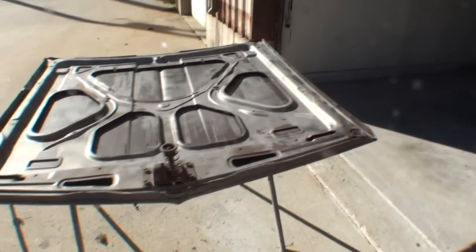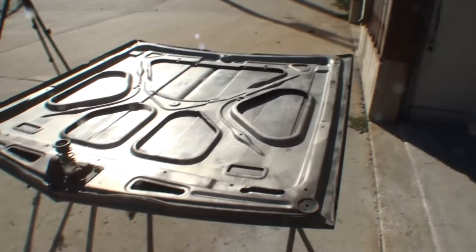The problem when you have metal soda blasted is that it leaves a very, very thin, micro thin layer of the soda still on the metal, even after you wash it off from the high pressure spraying of the soda. It almost acts like it penetrates into the top layer of the metal. Believe it or not, metal actually has pores, and if you put it under a microscope, you'll see all the pores in the metal. And we need to get all that soda off of this metal.